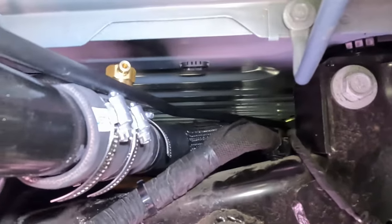I've got the tank dry-fit into the bed. Here's a nice feature — I have this Dodge with the 30K fifth wheel hitch and the puck system, and that made it very easy, within about three minutes, to just disconnect it and move it back. It's really heavy, so you've got that to contend with, but it made it very convenient to move it out of the way so I've got enough room back here to work. I dry-fit it, got it equidistant from both sides, and made sure I've got enough clearance so when I open the cover it doesn't hit anything. It's right below the tonneau cover fixture, so it's not going to interfere. I used duct tape on the bed and put registration marks on the tank as well as on the duct tape, so when I pull the tank out to drill the holes I'll know where to put it back.